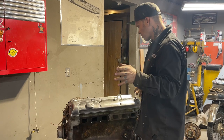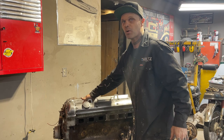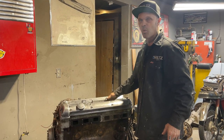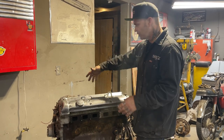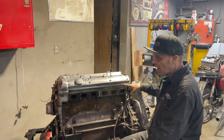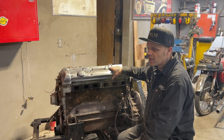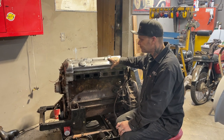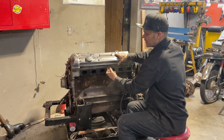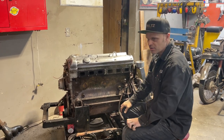But as we're going right now, if nobody has watched this video yet, we have three broken spark plugs out of this engine. We welded on the top of them, put washers down, then put nuts on top of them, and we turned them out. We had four valves that were stuck, and the valves were stuck open. We did not turn the engine over. So we started lubricating with the penetrant inside here on the valve stems. I'm glad we didn't make the mistake and score one of them, because that's a no-no.